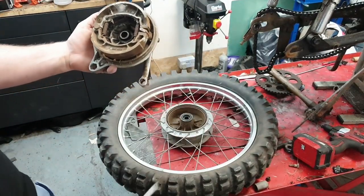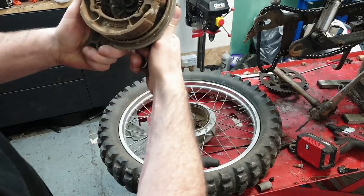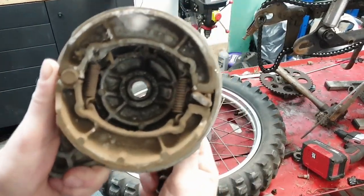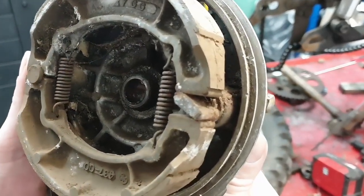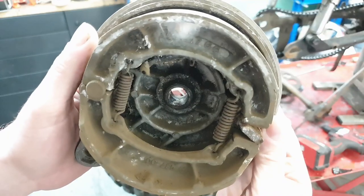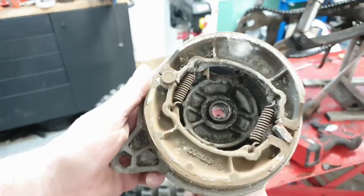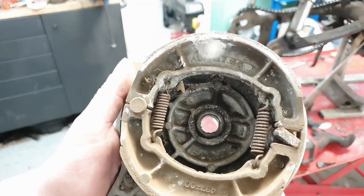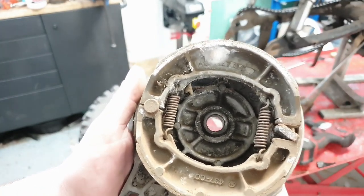There's the problem - the cam is already a quarter turned, that's its resting point. You can see how nasty that is - it's completely covered in rust, so that's going to be rusted solid inside, and that's going to be why the brake is dragging. Got a spider's nest in there as well. This is why drum brakes work so well - and when I say well I mean terribly - because they hold everything in that you don't need for braking. They hold heat because there's nowhere for the heat to go, so they'll overheat and let you down.